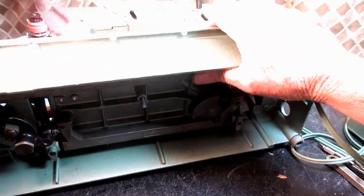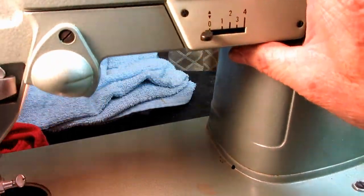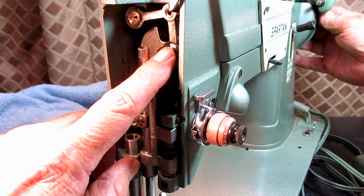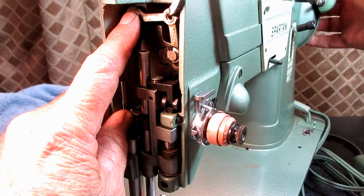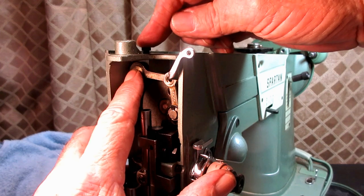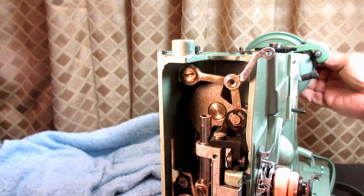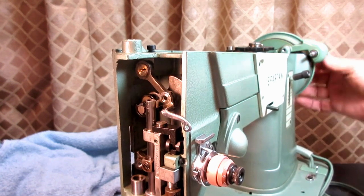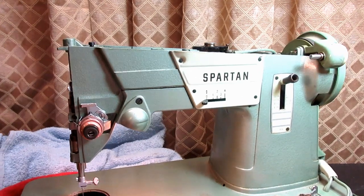And one other thing that you will see, where people push this hinge stud all the way and tighten it, and then they push this all the way in and tighten it. Sometimes people tighten this one first because the screw's right up here. They held this in and tightened this screw, and then they went over and pushed this in for sure and went through the body down in and tightened that screw. And that really can make binding. The first time they turn it to see how they did, they should say, wow, I did something wrong. It's so hard to turn. Okay. You might not have seen that before.